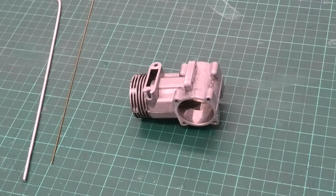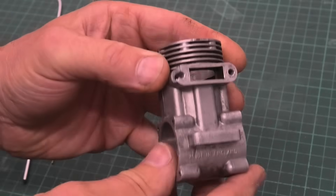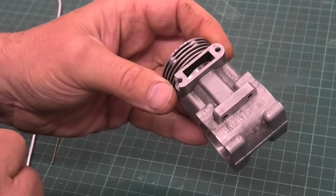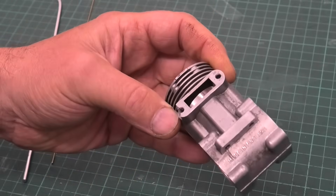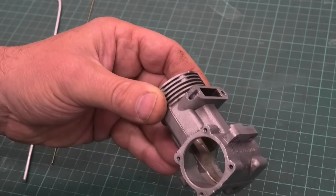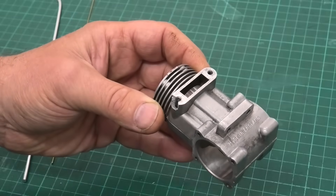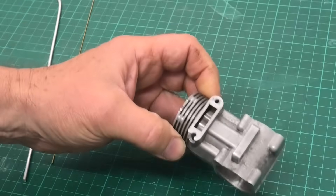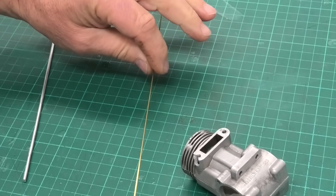You can see there how that has just ripped off a side of the crankcase where the bolt screws in. There might be enough thread there to still hold the exhaust on, but it doesn't look good and it won't be very strong. So what we're going to do is try and build this area up and make it strong enough to be useful and look good as well. To do that we're going to be using some 1mm brass.